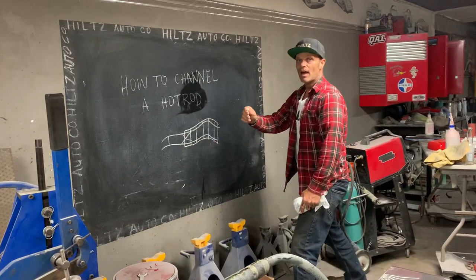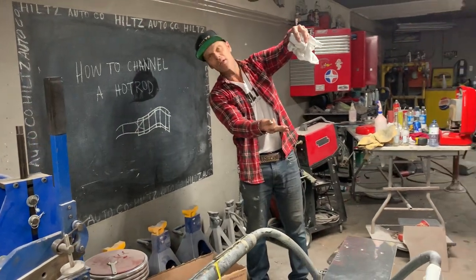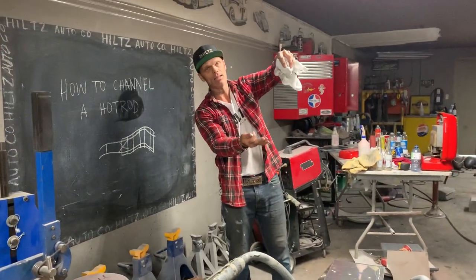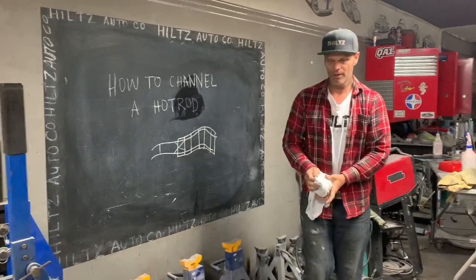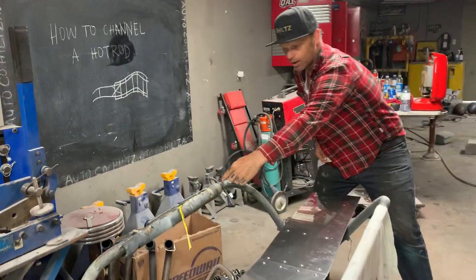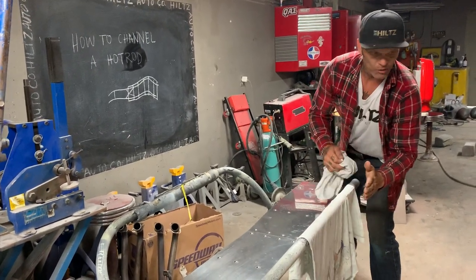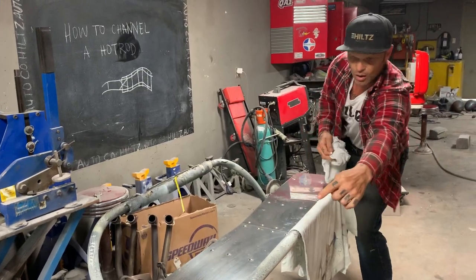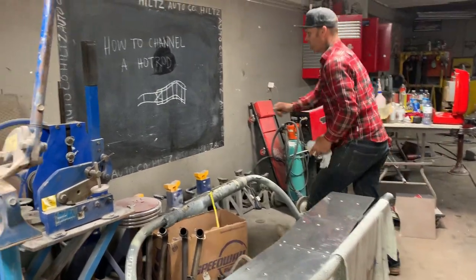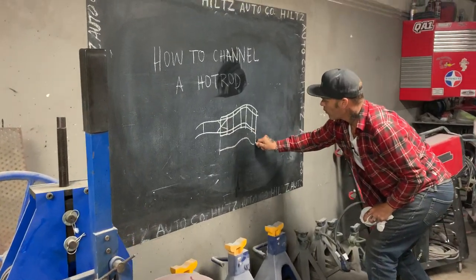And then what we do after that is a trick: I would take probably a foot or a foot and a half of 18 gauge, and I will weld it on the side. So if I have a piece of square tubing come across here and come across here, and a piece of square tubing on the side, I will take a piece of metal like this, wire, and I will weld it to the side of this and weld along that square tubing. And that apron will go right along from here all the way up there.